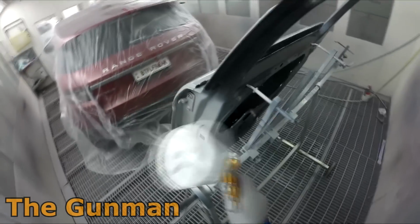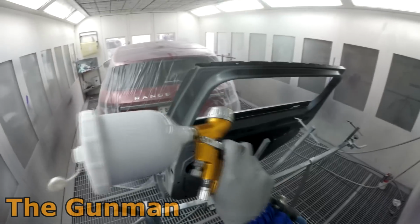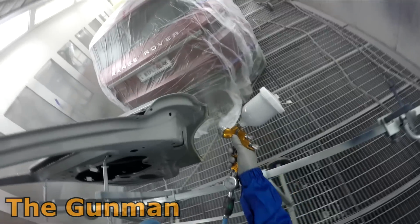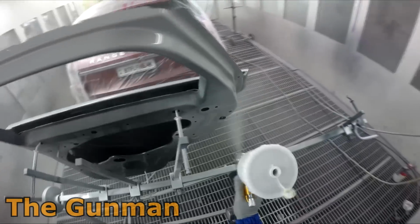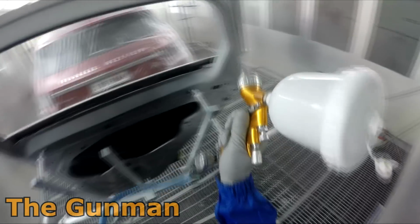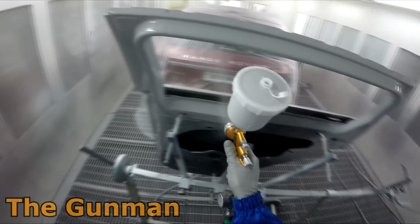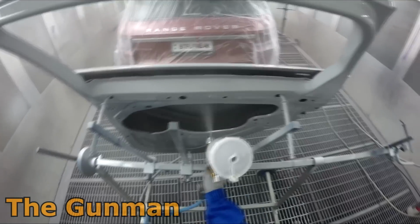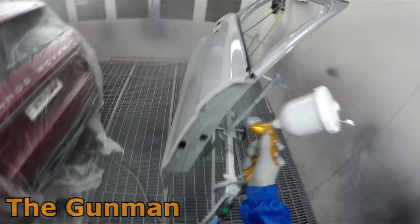It literally is just one medium wet coat, so it's still closed, so that you're getting coverage over the black panel, so that you're not trying to get full coverage out of your red over the top. So this is also acting as a bit of a ground coat, and you'll also see later on what I'm going to do is put a coat of this wet on wet primer over the surrounding blend panels, so the back of the front door and the front of the quarter panel, just to make sure that the color's going to match.